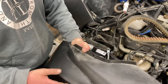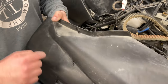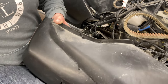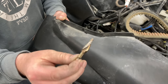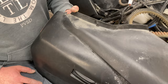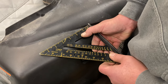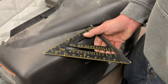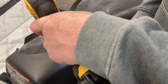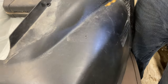There's quite a bit of room, so it should be good. I'm going to drill two three-eighths holes in the shroud from the top down — drilling plastic leaves little burrs, so coming from the top makes it look nicer. We need three-eighths holes for the three-eighths bolts. I'll use a square to keep the terminals parallel to the edge of the cowling, spacing them about two and a half inches apart and in line.